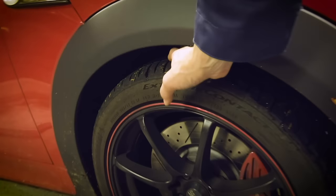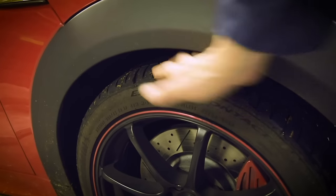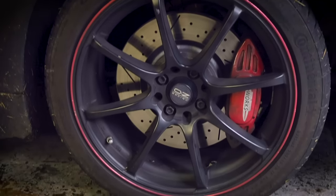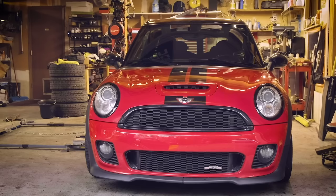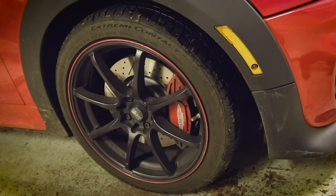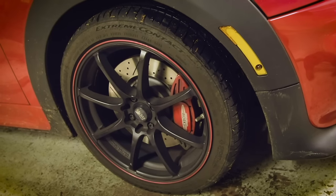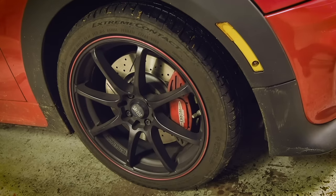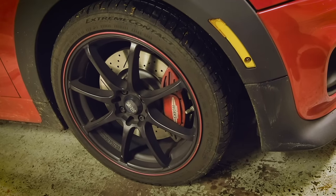You're going to just want to make sure you've got enough remaining tire life, and if you don't, consider the budget that you might need to buy tires as well. Another wear item on the Mini Coopers is the control arm bushings. After about 80 or 90,000 miles or so, they can wear and cause a little bit of shudder as you're going down the road.